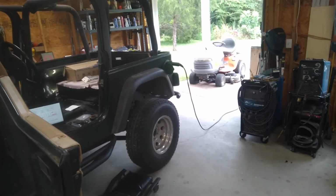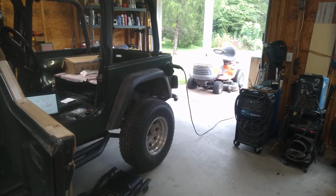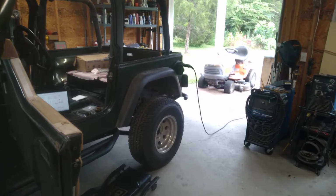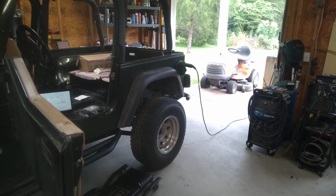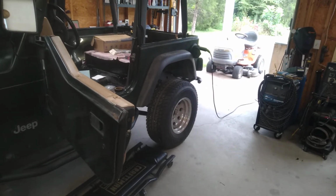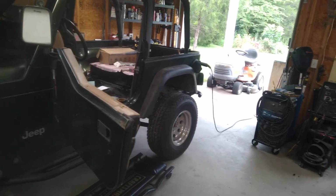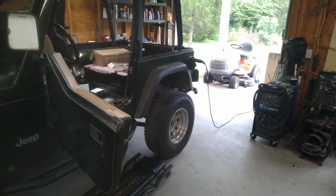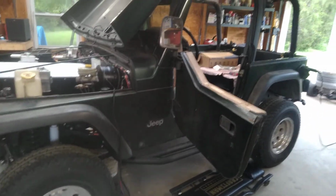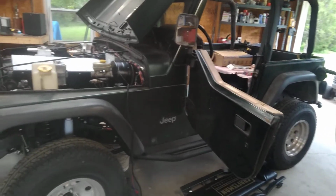And then on the fuel tank battery box, I actually had the first and the second cells backwards. Now I don't know if I had done that internally on the cell tap BMS board wiring, or if I'd done that on the Anderson connector. It doesn't matter. All I did was disconnect the Anderson connector and fix it, and then went through and double checked everything with the tester from Orion, and they were all good to go.